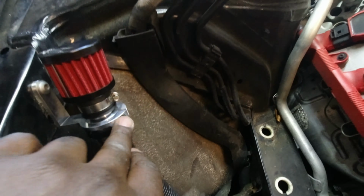Obviously, the tube, tighten these clamps for the hose, and also back here, a zip tie, the extension piece. And that's it, man. So it's pretty straightforward. It took a little time because, like I said, no instructions, but pretty much that's it. Heat shield, that's probably the one that took me the longest because I had to make sure that all these rubber seals are installed in the right places because they are there for a huge reason, which is to keep the heat away from this intake. But got it done. Now let's go ahead and do our first startup.